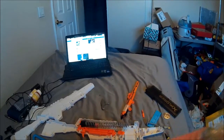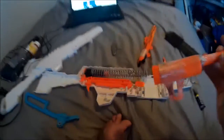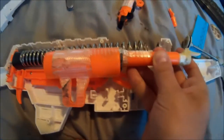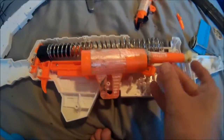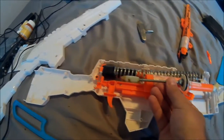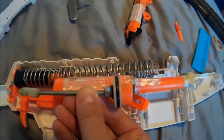Okay. Don't worry, that will be fixed. But you saw that get launched across the room. Look how much pre-comp I have, guys. Okay, the plunger's normally here, okay? The pad is another 1/2 inch. So if you look at this, that means that my plunger rod's about there. Look how much pre-comp I have.